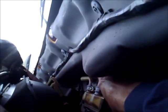There are a couple of screws right there holding that in. I want to take a hacksaw and cut these pipes off so I can pull them out through the other side. I'm not going to try to get those hoses loose. I'm going to take the whole pipe out with it. So I'm going to unscrew those, and then I'll show you the hacksaw in, and I'll pull them out, and then we'll lift this up and out of there.